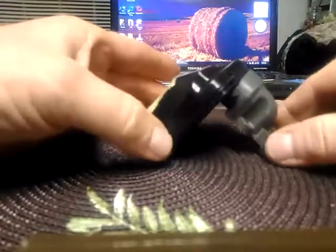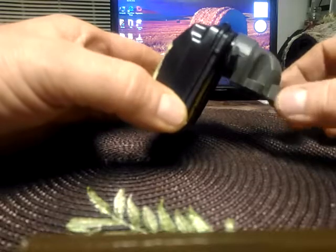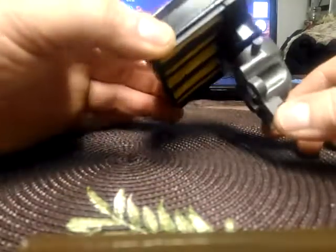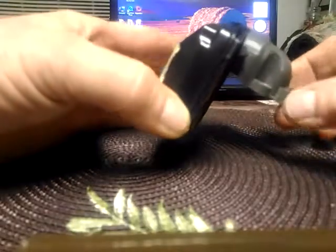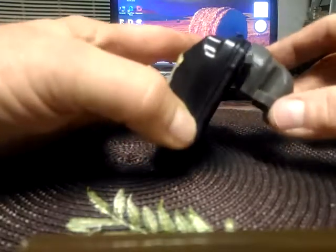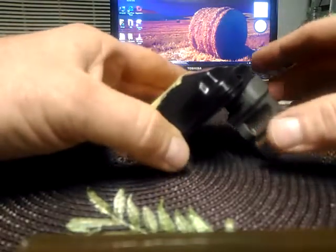I am demonstrating air filter fitment for the Husqvarna chainsaw. This is the improper fitment in my opinion. Please notice how it wiggles when assembled into the intake elbow. Even when held by the retainer clip, it still has an air gap allowing wood chips and shavings to enter the engine while the saw is running.